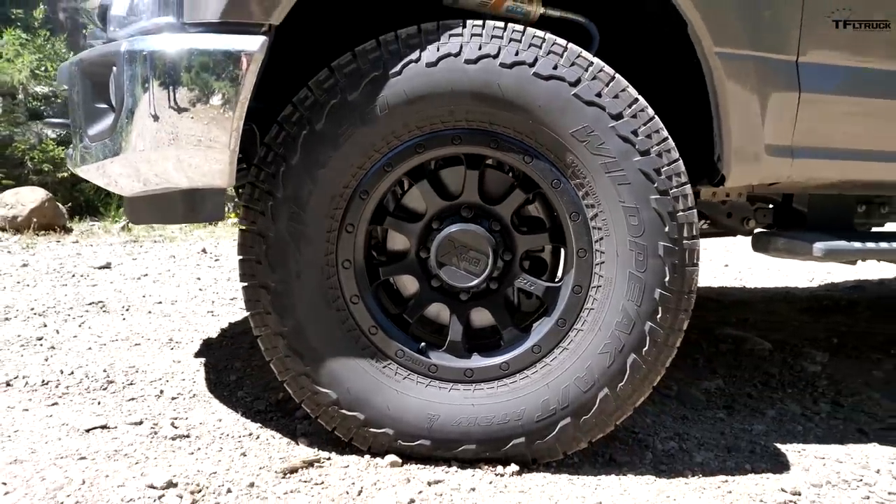The biggest problem we're solving today is actually the speedometer correction, and it has everything to do with the tire size. It's a wildly different size to what came on the truck originally, so the speedometer is off, the mpg meter is a little bit off, the odometer is off — everything is off. But this custom tune allows me to actually define the precise tire measurement so everything is correct.